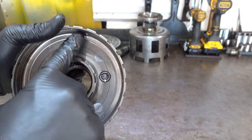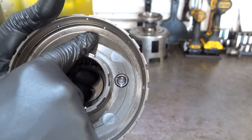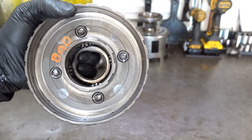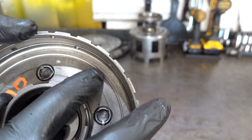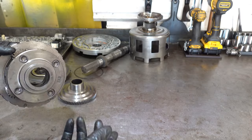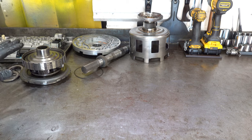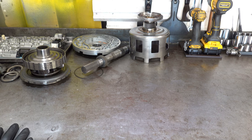And you also have some damage here, which was not as obvious on initial inspection. You have some pitting, and you have some more scoring. This is metal literally turning the face here by some tiny amount. You got some damage up in here. This whole thing is scrap metal. I would never reuse it. Maybe you could take the pinions out, and maybe these gears are okay. You can salvage them and reuse them to rebuild other planets that have good housings. But as far as using that planet again as it is, or even trying to rehabilitate it, I would not recommend it.